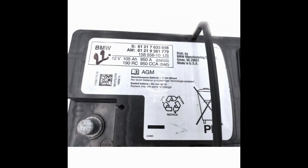Having the wrong battery rating caused a lot of problems. If your car has a specific battery rating, don't let anyone change it to a lower one and tell you it'll be okay. If you use a lower amp-hour battery, you'll end up with voltage issues. Initially it runs fine, but after a few months of consistently low voltage, you'll get electronic failures. Modern cars from the early 2000s onwards — especially BMWs — rely heavily on electronics, and those will fail over time.